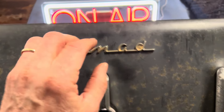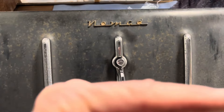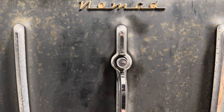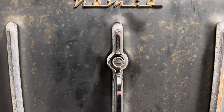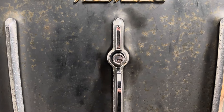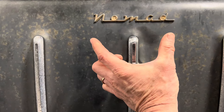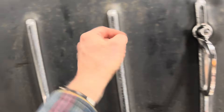The bell crank mechanism inside the door has a rectangular hole in it. When the key slot is in the horizontal position, it's 90 degrees from the rectangular hole on the bell crank. And when you push it, it takes the arms of the bell crank and pulls them together like that, pulling the rod in from either side.